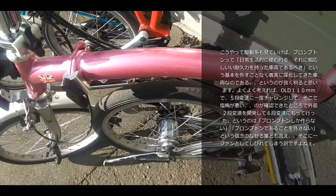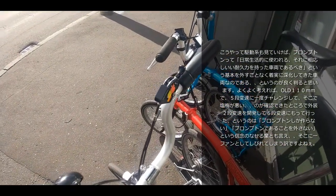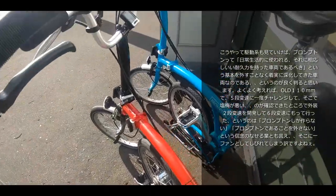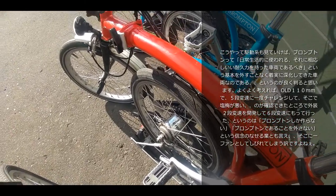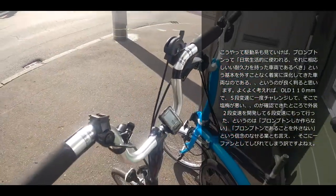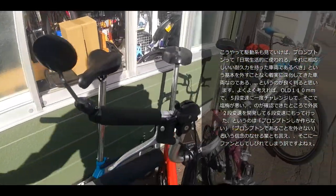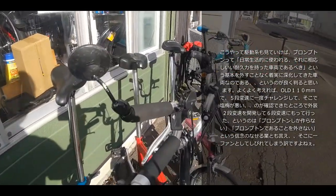What's important is that Brompton achieved all of this through steady, incremental improvement over roughly 20 years — that's what makes Brompton wonderful. Now let's look at the gearing. This is a Sturmey-Archer 3-speed internal hub — the old steel-shell version. The planetary gear-based internal 3-speed has a very long history and was already a mechanically mature, reliable system when Brompton adopted it. Over time, it gained the Brompton logo, transitioned to an aluminum shell, and was re-tuned specifically for Brompton with a 110mm dropout spacing.